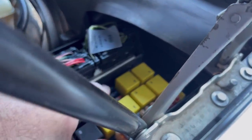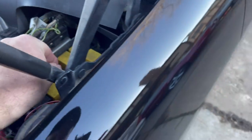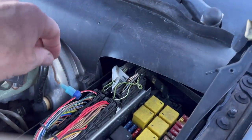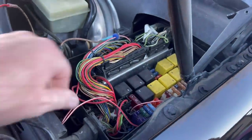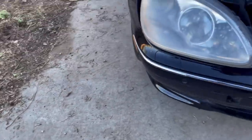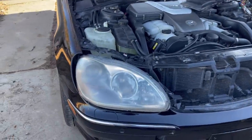I've already removed the fuse box cover. This is what we're looking for right here — 15, 15, 40. The 40 goes right there, and we're going to go back to stock. Let's see what happens when we do this. Thank you for your service. We got a 40 — we're just going to put it right in here. Then what else funky is going on? What is this thing? I don't like how it's tapped into that. So let's try to plug in a headlight and just see what happens. Right it is — we got the right headlight. No change. So I'm going to have to figure out the wiring on this like I did the wiring on that one, because you switch a pin and have to ground something special, and then these work, because these are the exact same lights as this car.